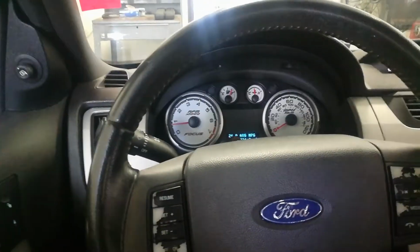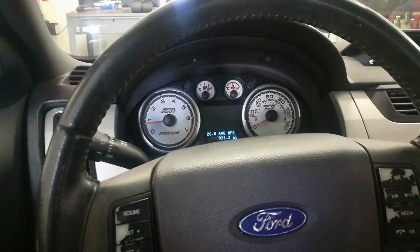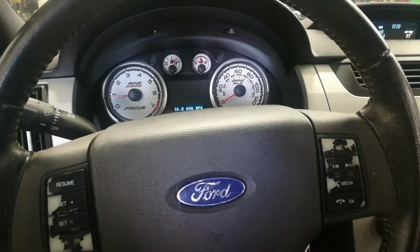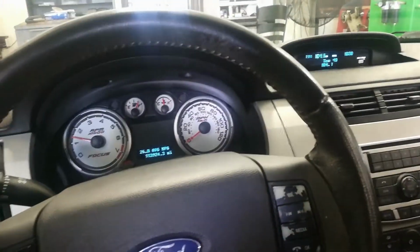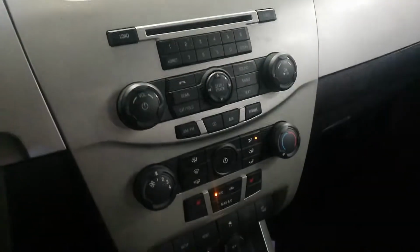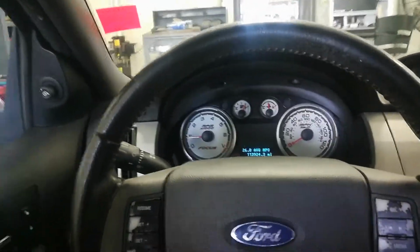And the cause of this is going to be the bad motor mounts, and usually it's the back mounts and the passenger side mounts. So today I'm going to be raising this car up, inspecting those mounts, and also replacing them, and see if we can make this go away and get any better. It's hard to really capture, but it is rattling in here. It's so bad. So let's get this car up in the air and take a look underneath and see what we can find.